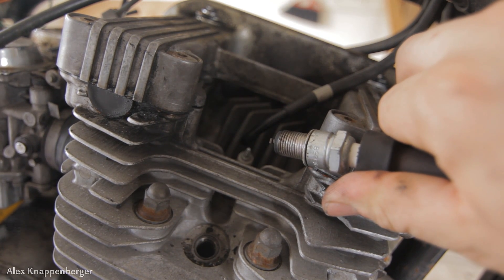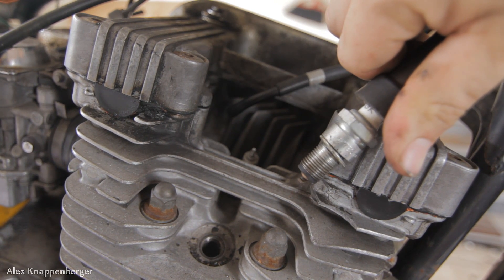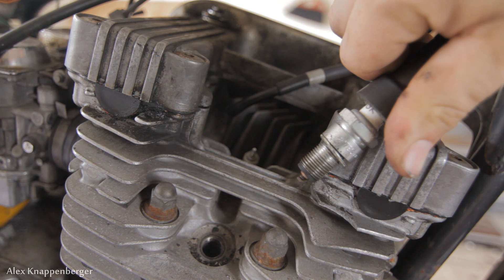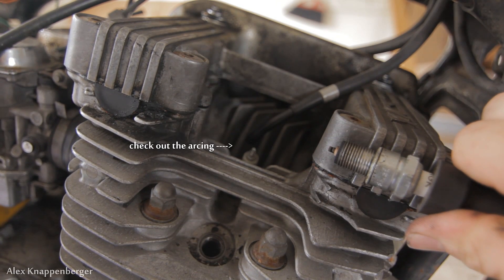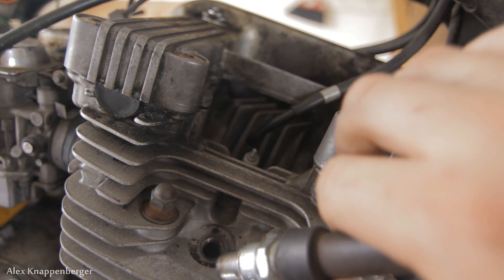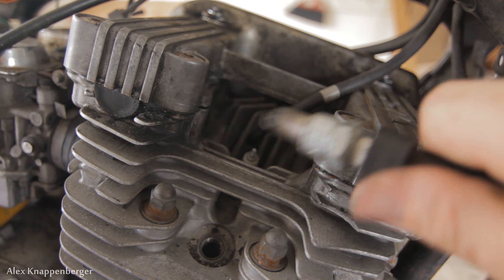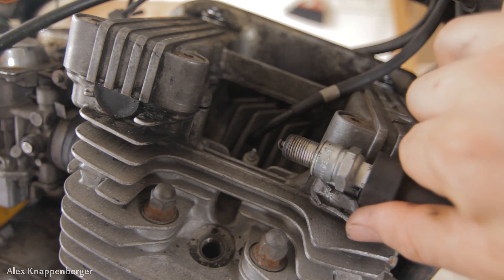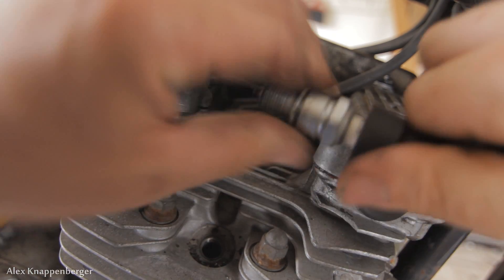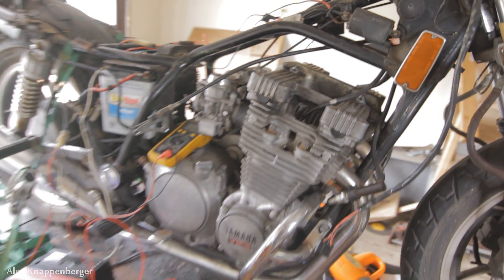Let me see if I can get you a better shot of that spark — I got the camera in just a little closer. This camera is only shooting at 24 frames per second too, so some of the sparks you might have missed — they might have just not gotten captured on this camera. But it is definitely sparking. You'll be able to see it in person; just ground the spark plug out to the engine or whatever grounding point, and you'll get spark. That's how that works and you can definitely check for spark any which way that way — it works really good.